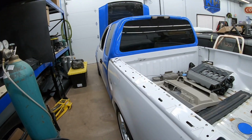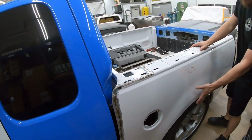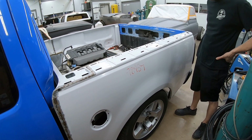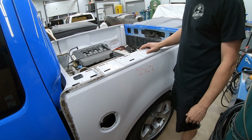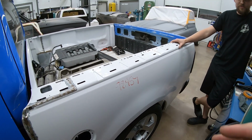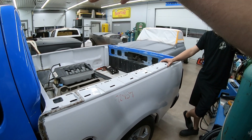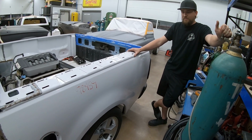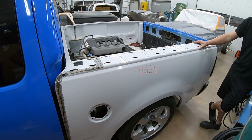So you're going to shave the door on this side? Yeah, I'll shave the door when I get into the flare on this side. I need to go get 2 more fenders from my favorite junkyard. Have you already centered your axle? Pretty close. I kind of got it roughed in there. But do you feel confident enough that you wouldn't think you have more clearance than you do, and then go put this side together and find out otherwise? Yeah, it's pretty close. I know I can get there with the adjustments and the Heims.